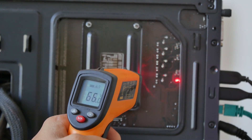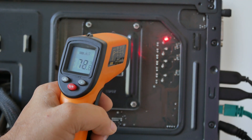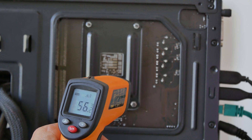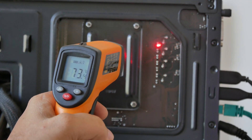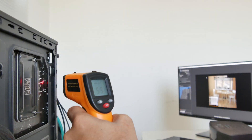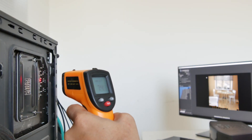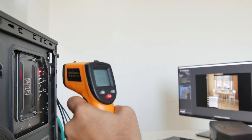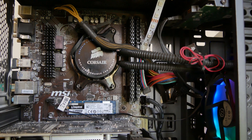Even though the back side is about 10 degrees hotter, we are still in a good range because we are using a Ryzen 2700X on this motherboard, and 70 to 80 degrees is very good for VRM temperatures. If you agree or want to discuss anything, go to the comment section. If this helped you, please like the video and subscribe to the channel if you're new. See you next time!